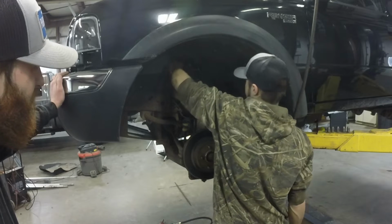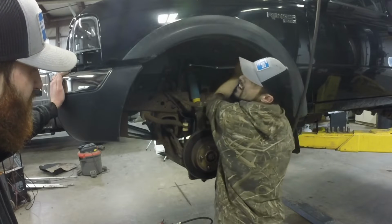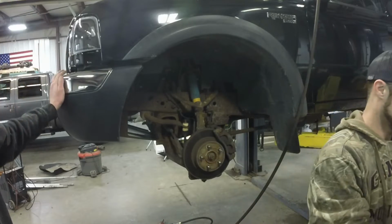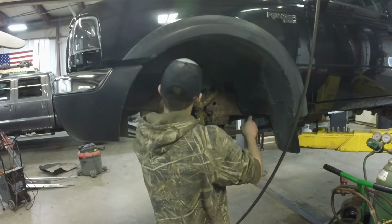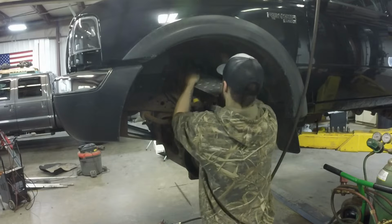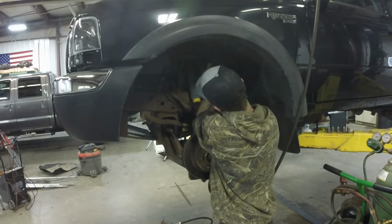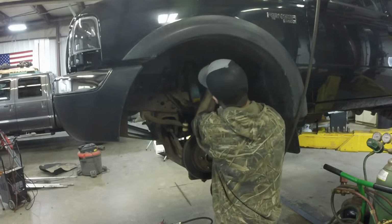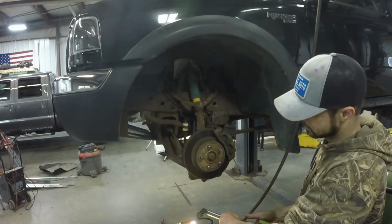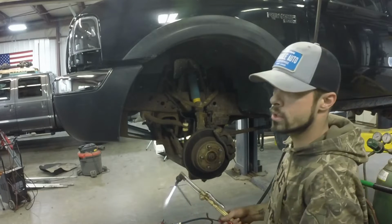Roasty beef. Now the whole thing's going to turn and it's going to be good. See how the whole thing turns like that and it's not coming loose? Torches! Anytime you're using torches near fuel lines, it's best to rig yourself up some sort of protection, also known as a piece of sheet metal or aluminum. This is how you remove a shock when you don't want to be working at it all day. Always wear your safety goggles, kids.